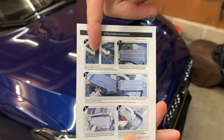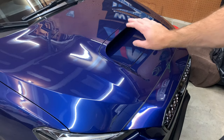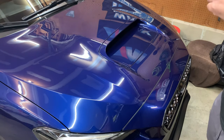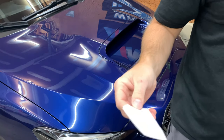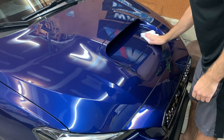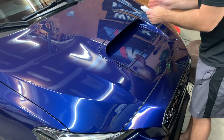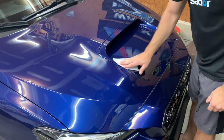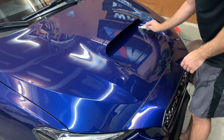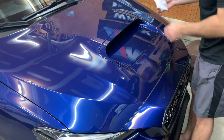There's a little pamphlet with the instructions: use the cleaner first, then put the primer, peel off the tape, then place it. The first step is the cleaner pad supplied with the scoop — it's basically just an IPA wipe. Swipe it down to make sure there's no dirt around the area. This removes any protection or contamination from the surface so it's ready to adhere.